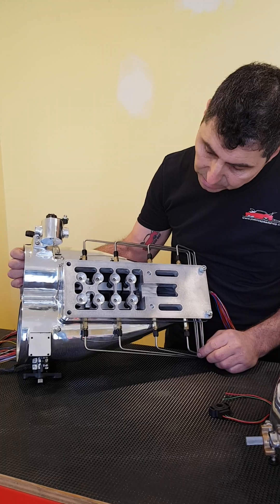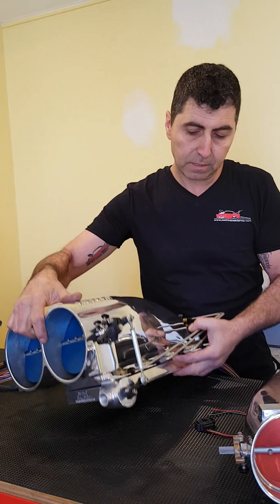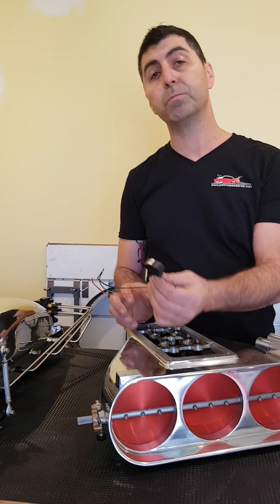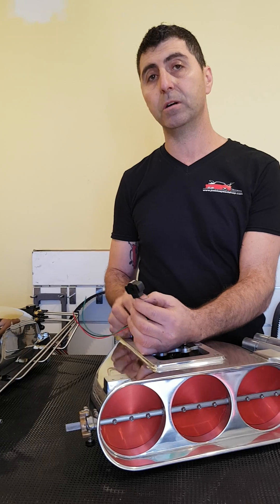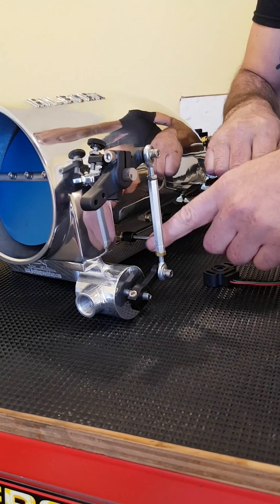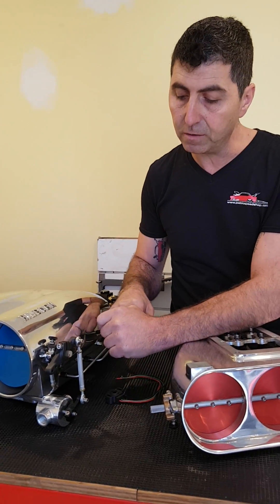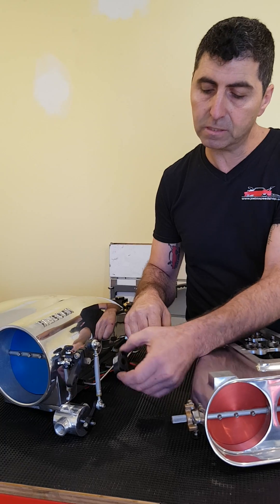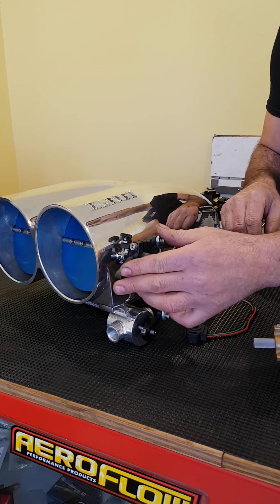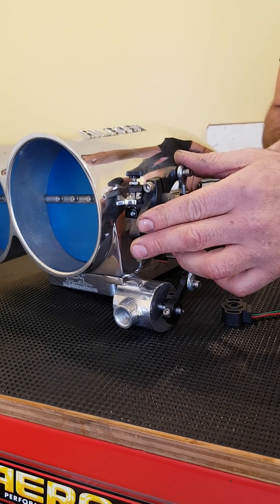This one's also got all the injectors and the wiring harness already connected to it. We also have the TPS switch, which is the throttle position switch — it tells the computer where your throttle is at all times. We make these housings here; this one's the JB002, which is designed to replicate a nitro barrel valve. The switch is fitted inside that housing, and as you activate the throttle it moves the switch inside and tells the computer where your throttle is.